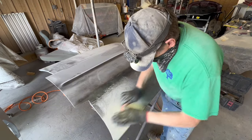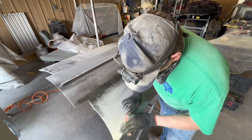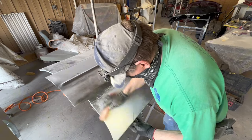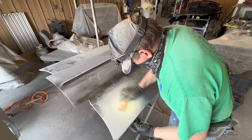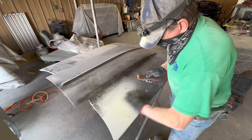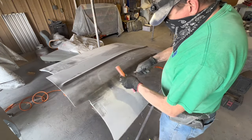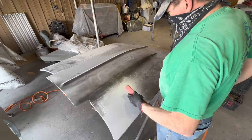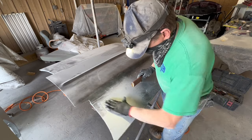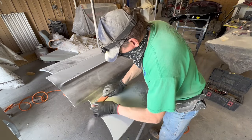Those of you that have watched my blocking or Bondo working videos have heard me speak of horizon, and horizon is the 8-foot fluorescent light on the ceiling shining down on your workpiece. And you may be able to get behind this hood and look across from the front to the back and not see a ripple in it, be straight as an arrow. But then you stand over on the side and get that 8-foot fluorescent light that's running lengthways on the hood, shining down on the hood.